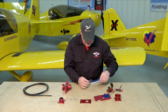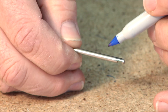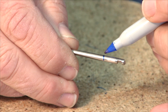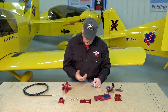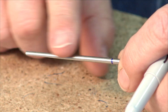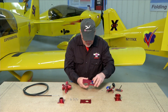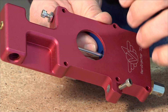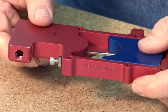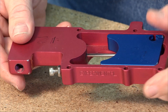If you need to change the needle, the easiest way is to start by marking the needle. You can see right here where the taper starts — put a mark on the needle that goes all the way around right at that point, because when you look up into the Aero Injector while it's mounted on the engine, you're going to be seeing the non-tapered side of the needle. The tapered side goes towards the engine. As you look up through the Aero Injector for tuning, you'll see the non-tapered side, so your mark needs to go on the back side. Install the needle so that this mark is right at the edge of your throttle slide — that's your initial setting. Then start your engine, warm it up, and get your high RPM setting so that you have the proper static RPM and the proper EGT rise as you lean.